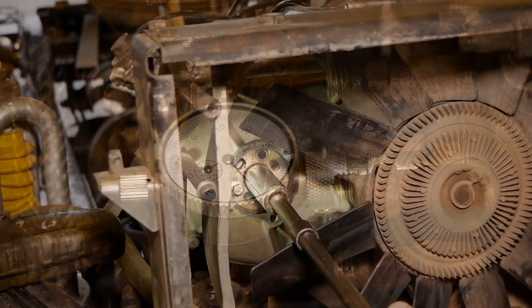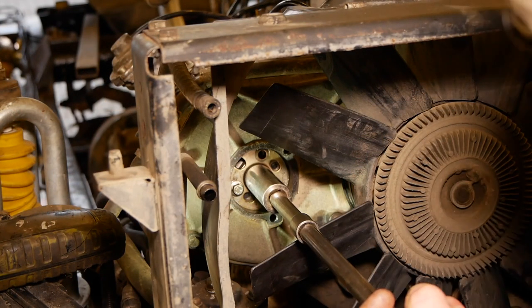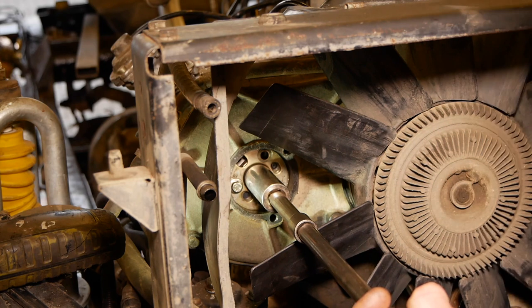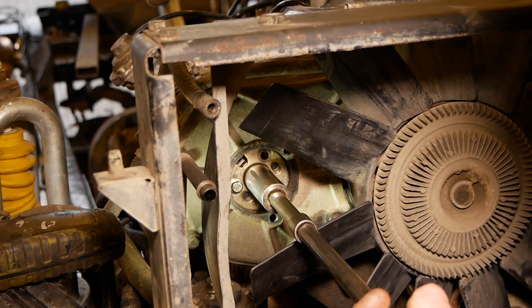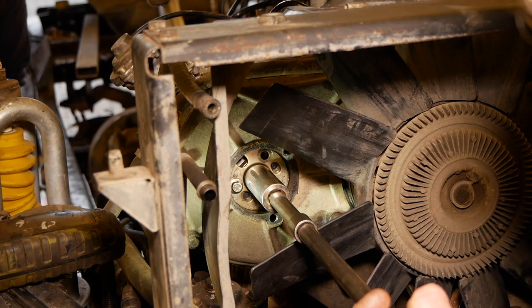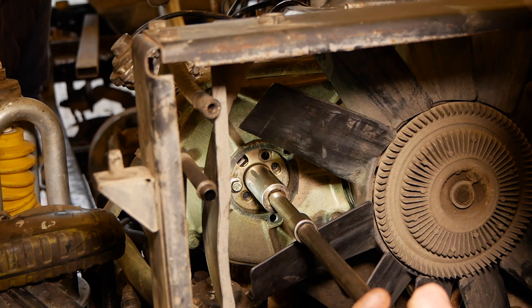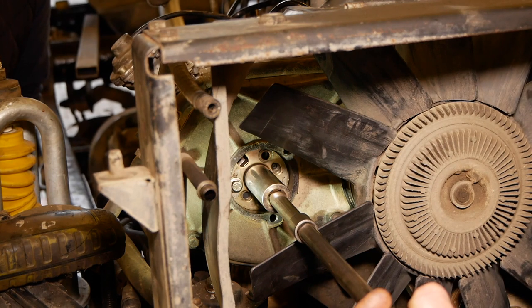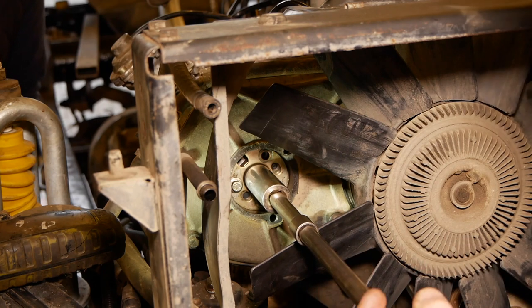That's spot on. From the front of the pump, guys, what I'm doing is literally rotating it that much to realign back to the pinhole. Now, I can't actually see the gauge from here, that's why you're much better off with two people to do this. So a bit more again. A bit more. A little bit on, back a bit. You should be about there, that's what it feels like. You can actually feel the tension on the pump as you're going round. You can almost feel where the position should be.